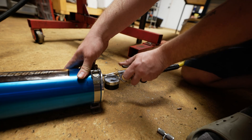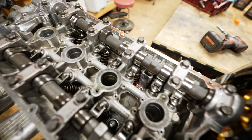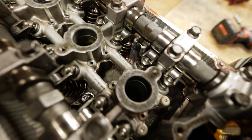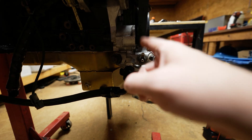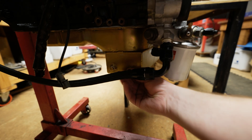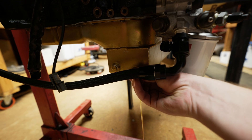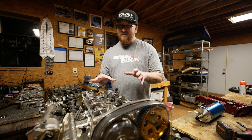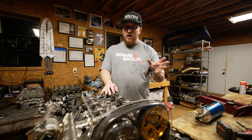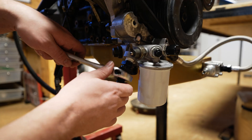So we're going to take the Schrader valve out again, hit it with compressed air and try to get the oil moving. I'm wondering if this port that I used for the AccuSump only feeds back to the pan and doesn't feed the oil galleries like I thought. We took off the drain plug and it looks like all the oil went into the pan. I really would like to pre-lube this block because when I built it, it sat through the summer — I'd come out and see the Permatex assembly lube all red and leaked out onto the ground.